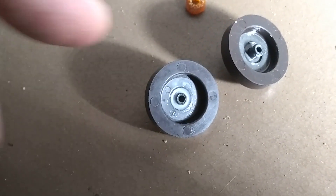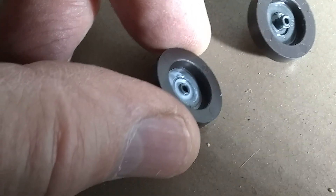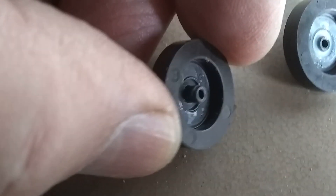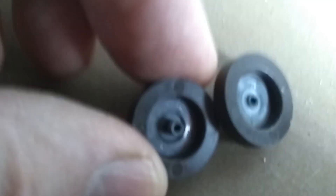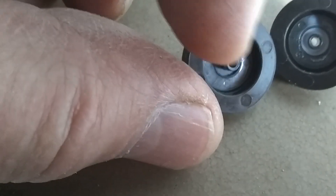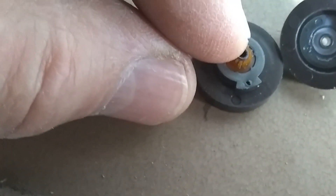The rotors in the two different motors go to different depths. You can see that this one is kind of deep, and the new gear with the good teeth has a longer part. This is the good one, but it has a different shape — this one will not work properly because of the length of this little part. So what I want to do is take the plastic gear alone from that one and insert it into the old rotor.